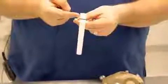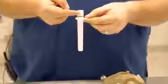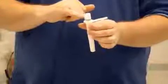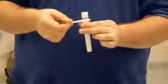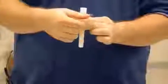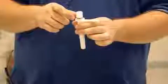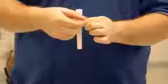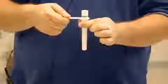The holes on the pickup tube are different sizes to allow for different overrun. There are 2 options available. The variable size hole allows for an adjustable overrun by selecting clockwise or counterclockwise, or if a franchise chooses a set overrun, all holes can be drilled to the same size so that no matter where the selector is placed, you'll get a consistent product.